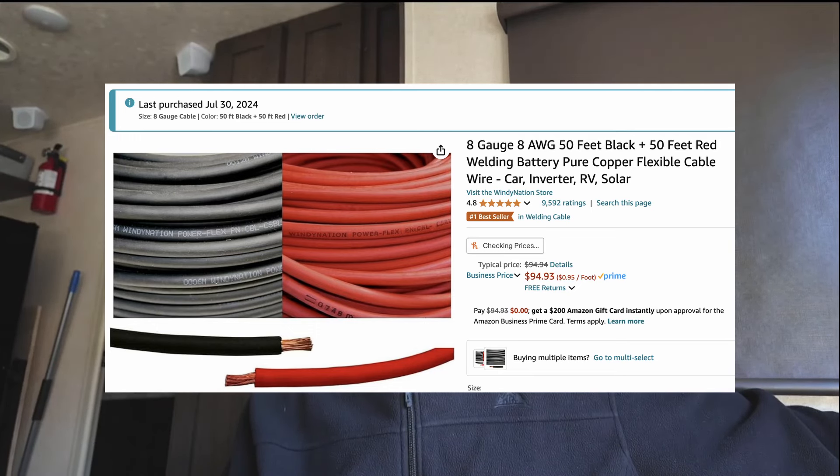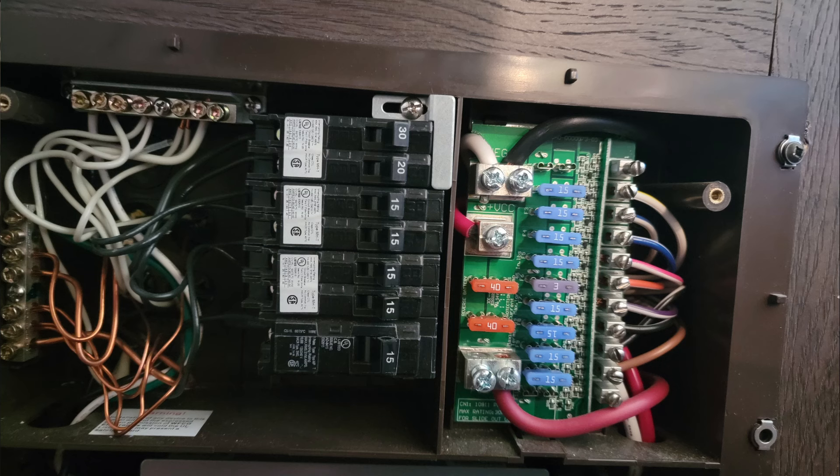The way I had it wired, the charger hooks to the battery and the battery hooks to the fridge, so I just woke up in the morning, turned it on, and let it recharge while going about my business — no need to unplug anything. Then we got the 12-volt refrigerator properly installed with the help of my buddy Mike. The longer the wire the thicker the gauge, so I used 8-gauge wire, ran it into the panel, and hooked it to an empty fuse slot.